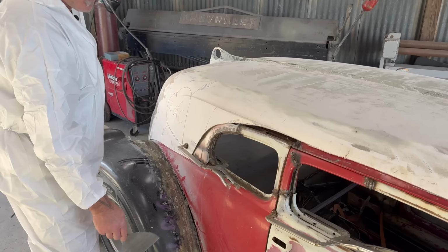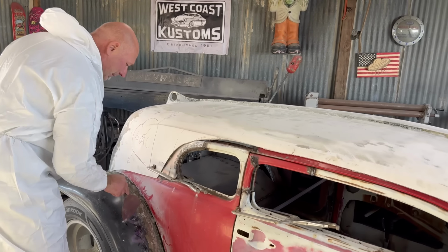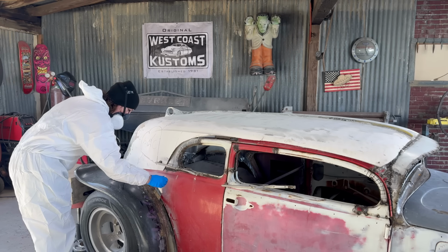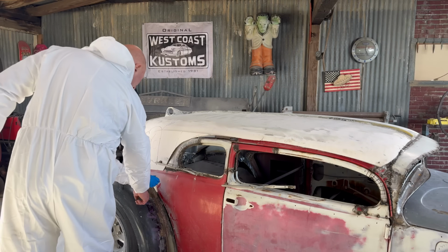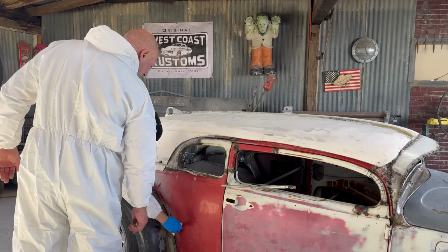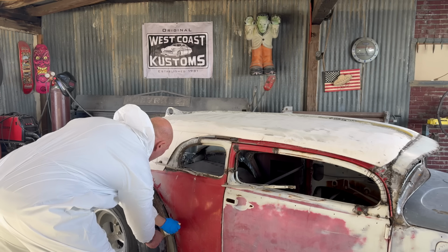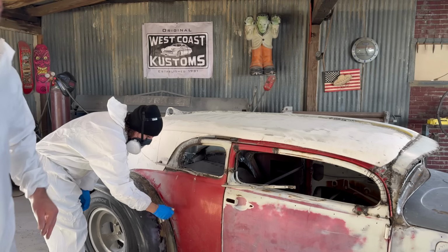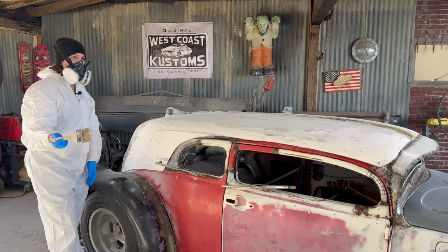So if you want to grab that brush with the acetone trick and start patting this down. Just like this? Yeah, you're trying to push down the hairs that are standing up. See, you got all that. Just the flatter, the better. And you'll also see if there's air bubbles, maybe right here. So you hit on that. See, look, the color changes. Now the air's out of it. How does that look? Lovely.